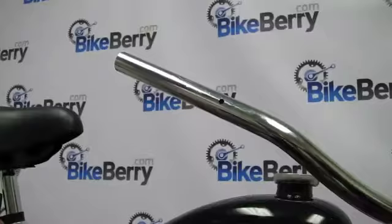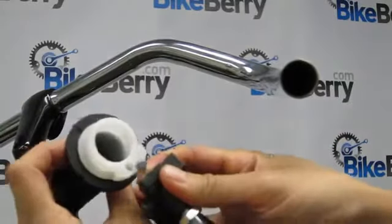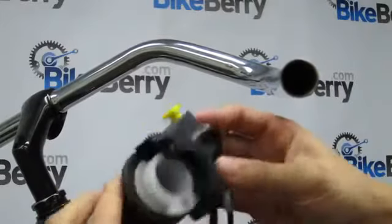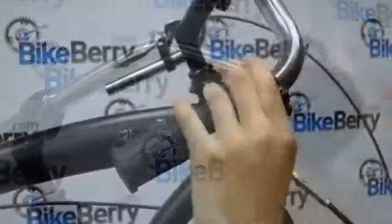Once you've done so, grab the throttle cable and thread the L bracket side of it into the kill switch housing. Once you have it tightened down, reinstall it on the handlebar and screw in the top piece.